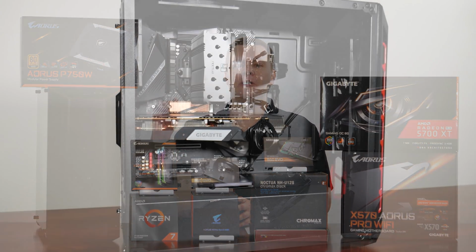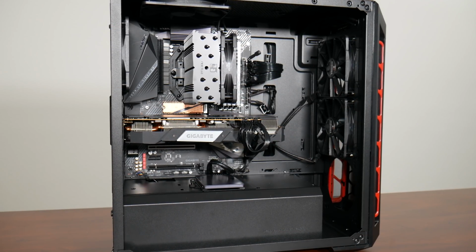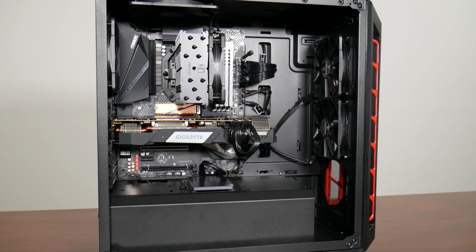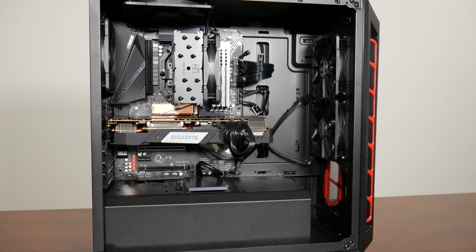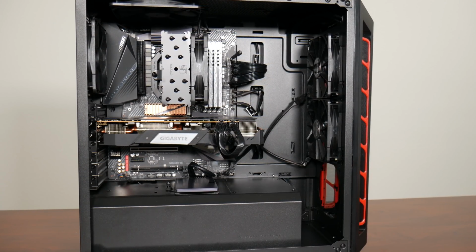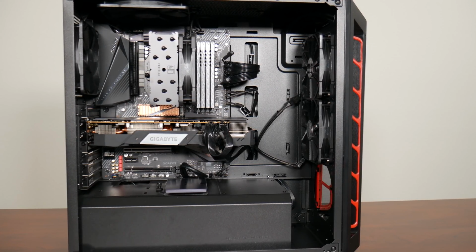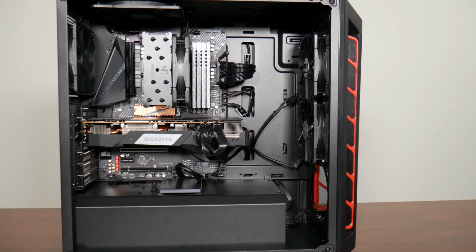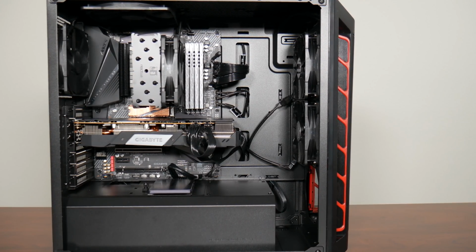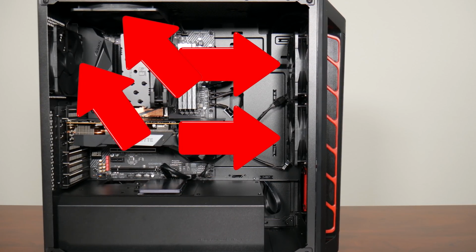We installed 4 fans in this case, 3 120mm and 1 140mm. So yes, there are $80 worth of Noctua fans in this case. $140 of the $2,000 budget went to Noctua between the cooler and the fans. But this system is basically silent running, and the amount of airflow means that temperatures will never be an issue whatsoever. 2 intake fans, 1 exhaust fan, and 140mm on the top, also exhausting out the top.